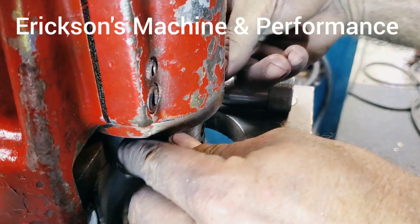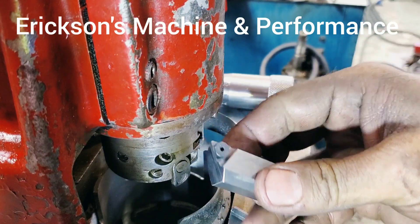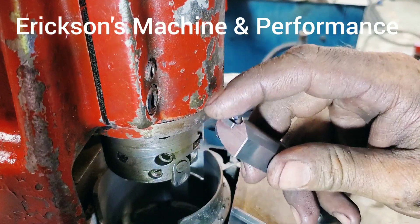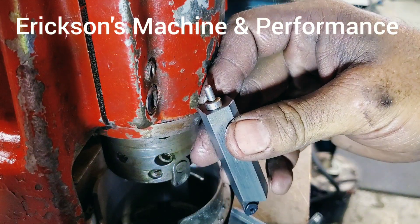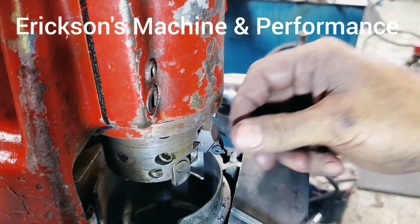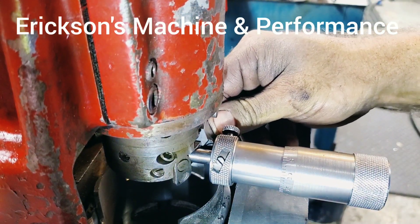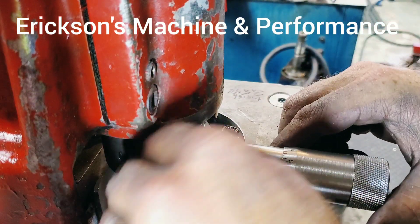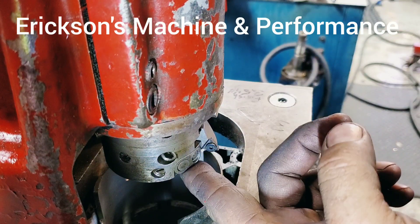Now that it's up, we're going to rotate this over so we can get to where the cutting head and micrometer go in. These cutters are actually made by a company called Beam Equipment — they make them for all different boring bars. It's an indexable cutter on a ground stick tool. I've used them on every boring bar I've owned — they're phenomenal. We set these into the bar; they're spring loaded. The micrometer now goes in, which is preset. We make sure the tool is moving and actually touching the micrometer, then lock down the set screw, back the micrometer out, and close the dust cover.